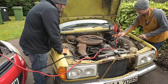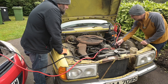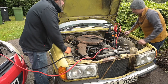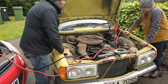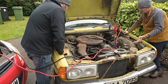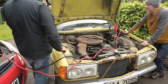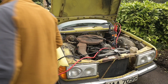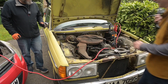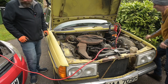You're going to need: oil filter, spark plugs, rotor arm, distributor cap, HT leads - I think you might be able to clean them but they're a mismatched set, very dirty. You'd normally do all the oil and filter as an annual service anyway. But looking at the odometer it's not even 70,000 miles - 69,568 to be precise. That's incredible for a 1978 car.